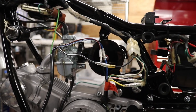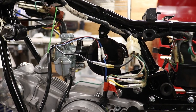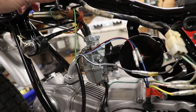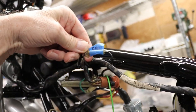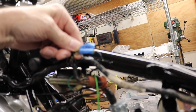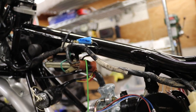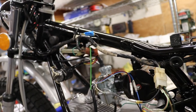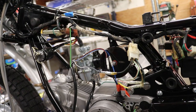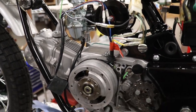So that is about all that's to it. If you don't wire it properly, the bike won't turn off. And finally, one thing I did initially wrong is the initial coil plug-in wire is retained, so you don't need to change that. So you just plug the coil into the harness as normal. It makes a really nice hot spark even at low RPM, and the advance curve also seems to work just fine on this system.